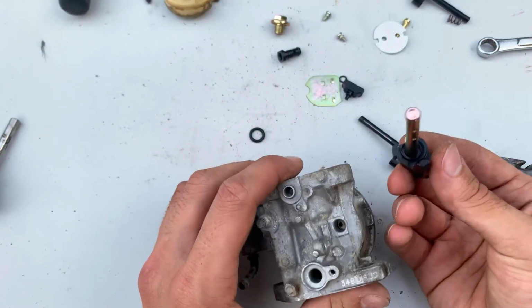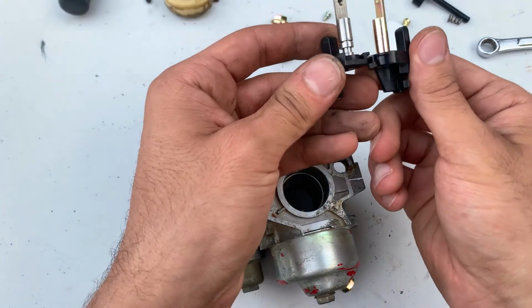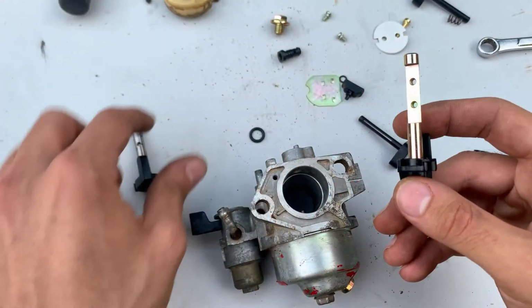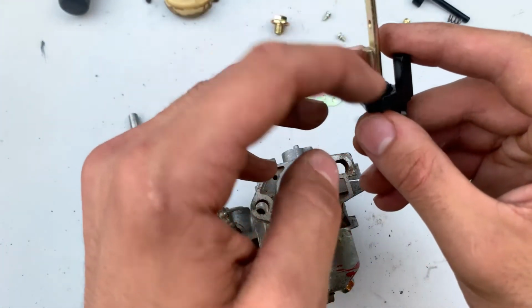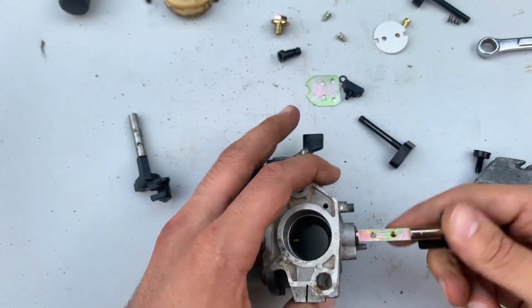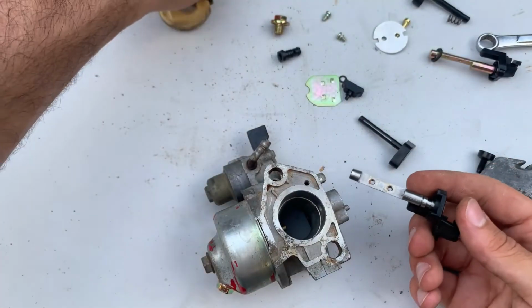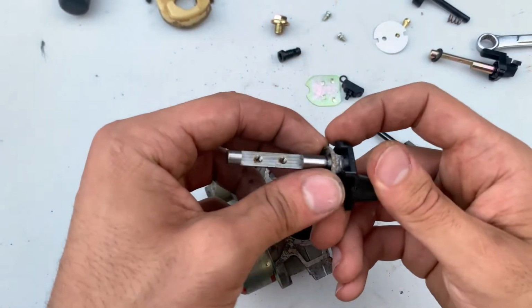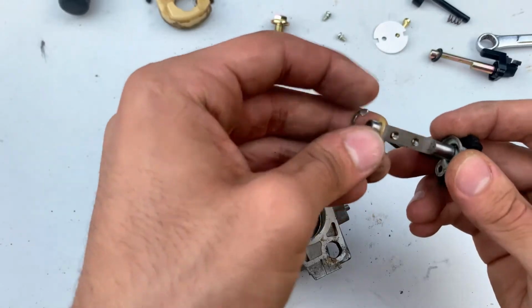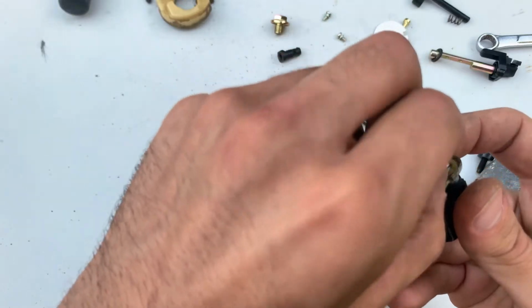And as you saw that gasket right there, that gasket actually went with that bolt for the float bolt. That bolt that had the flange nut on it, you put that rubber O-ring on it and it will work. That does not go on there. And this part actually didn't work on my GX340 engine either, because it was a little bit bigger. I guess it's for the 390. So I just went ahead, put my part back, the retainer back on, that gasket thing, and the C-clip.